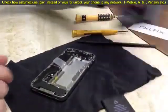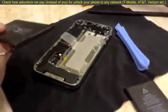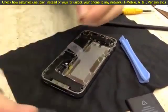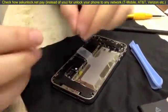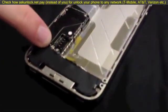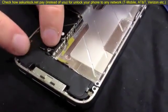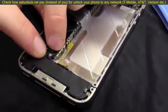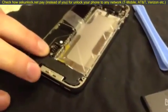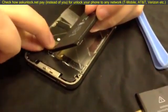The new battery has a clip on it already. All you're going to do is set it in there and clip it, but first make sure you place the little grounding piece for your wifi antenna in there. It has a hole for the screw so it's easy to know how it goes in. That piece is your wifi antenna and it needs to cover the correct spot when you put it back in. Hold that with one hand, take the battery and clip it with your other hand — you're going to hear it lock in place.